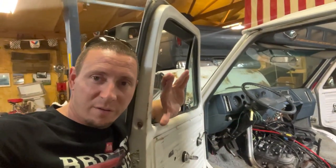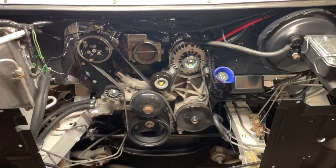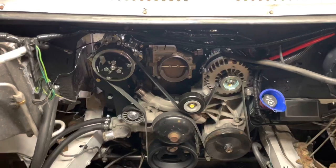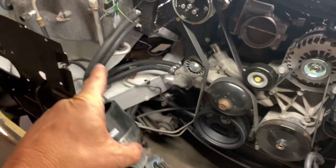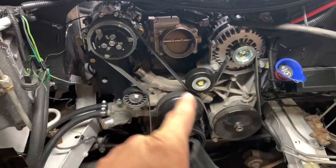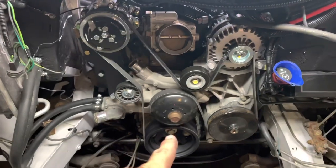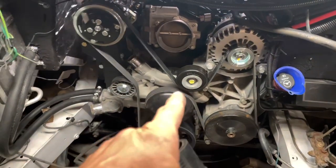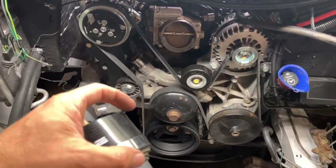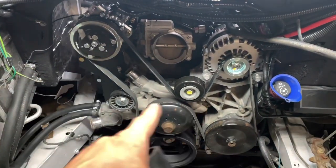Okay, maybe like all your fingers crossed, and yours too, and your toes. Well dudes, I'm getting real close. I've got my heater core hoses on. My belt is on. I was turning this engine over just with the breaker bar, trying to see what these pulleys were doing and the belt riding on them. Because this is so far from there and there, I was concerned with this distance that with a smooth pulley that belt might walk.